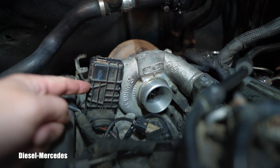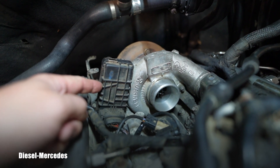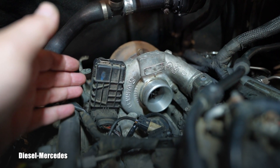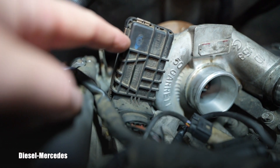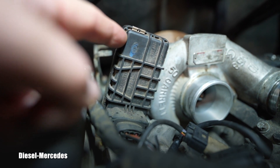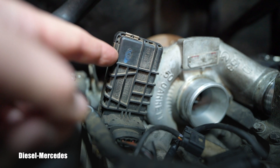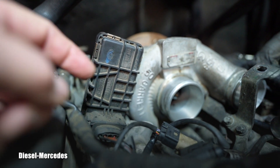When this unit fails, you will basically be entering limp mode because the ECM — the computer — will be afraid to create too high a charge in the system and blow something up. So if there is a malfunction on this, you will definitely be losing power and entering limp mode, with possible fault codes like P2510 or P2044.